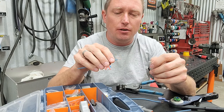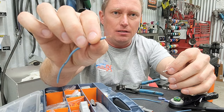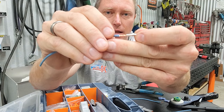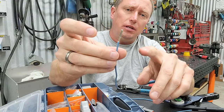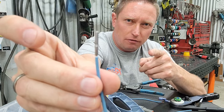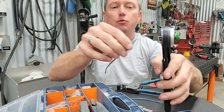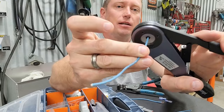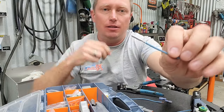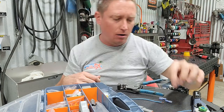So let's go ahead and do a little demonstration here and assemble one of these JR Ready Deutsch connectors. I've got myself some 16 gauge wire — I did go ahead and twist it to keep it nice and tight. I'm then going to take my little female connector terminal right there and slide that over it. You'll notice I've been pretty careful about the amount of insulation I've pulled back so there's no exposed wire — it just goes straight from insulation to the terminal. Then I'm going to take the crimpers, already set to 16 gauge, slide this into here and squeeze it pretty good. You can see those four little indentions on there to hold that little female terminal onto the end of that wire.